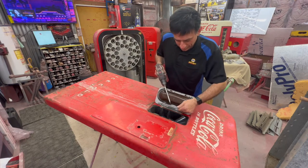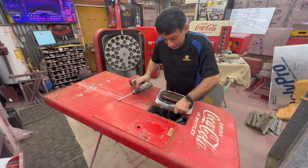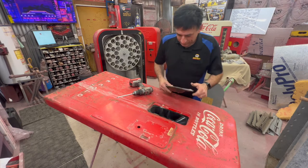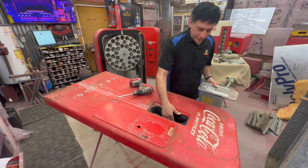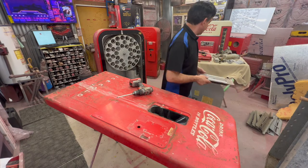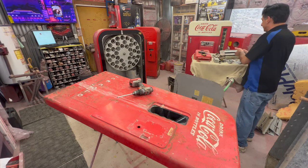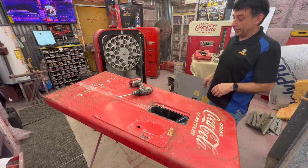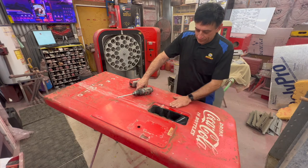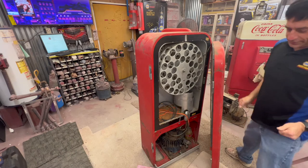The sandblaster guy will probably like it a lot more if the insert is removed. This one is in there actually pretty good. Usually that's all loose — if they're loose, take that thing totally out, re-glue it back in. It's like a black tar. You can use a totally different product than what they used originally — you can get it at an automotive body shop center and caulk that back in.